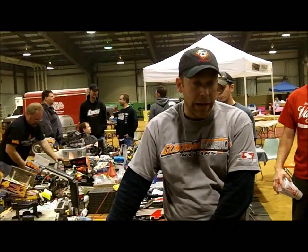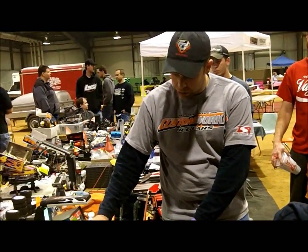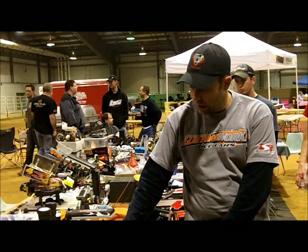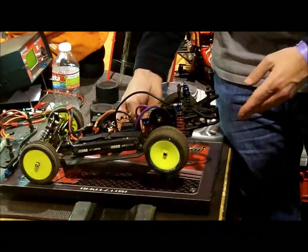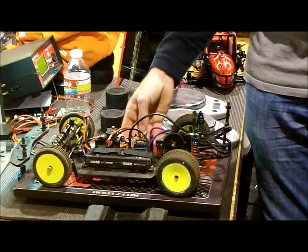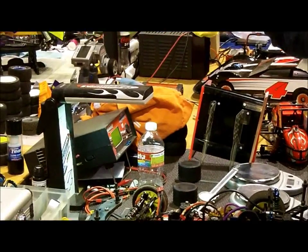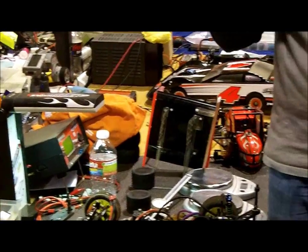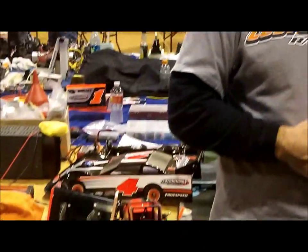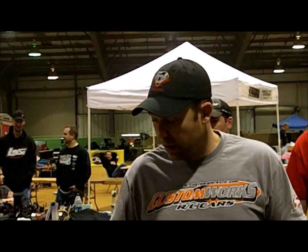It's easy to take your imagination, and if the car was sitting like this, it should be tight all day long. It should never get to the front. If its rear ride height's way higher than the front, it's already acting like it wants to turn in. It's going to be way aggressive, and it's always going to be lacking forward grip, especially when we're trying to keep balance. I say balance is maybe just ration or spend wisely the little bit of grip we've got.